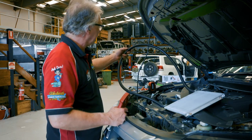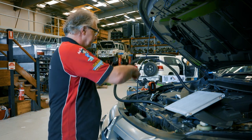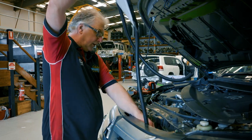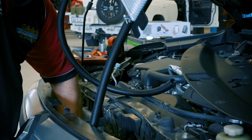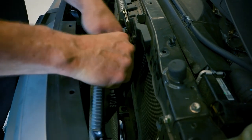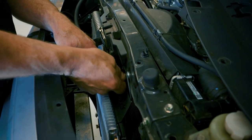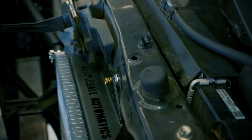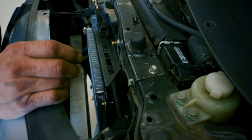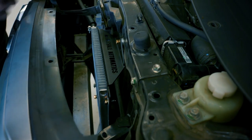Before we lower it down in, we'll cut the hose. Now we can lower it into place by routing one hose underneath the rad support bracket. With the M6 bolt provided and the three spacer washers, we'll just bolt that in loosely and now we can get the last bolt in. I like to do this from underneath — hence the reason why we take the bash plate off. Some people find it very difficult to get their hand down there to get that last bolt in, so we do it from underneath.